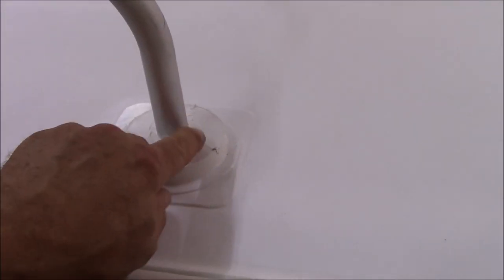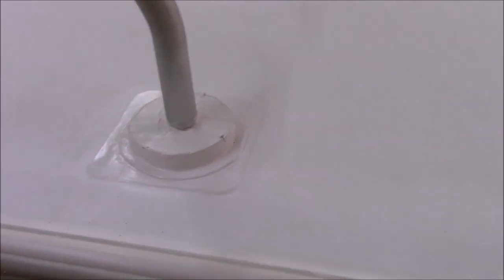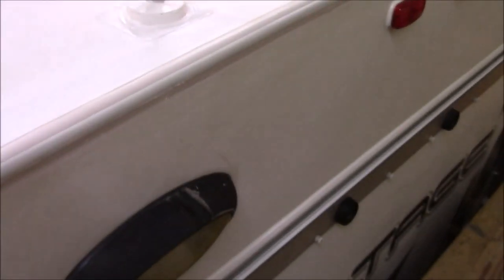And typically that's how the caulking would breach, and then you have some issues with rotted wood because obviously water gets in there. So we put two strikes of caulking along everything. We replaced all the insert trim running around all the lights here. We put some gutter spouts on the end, and again, all of this is heat welded in here.